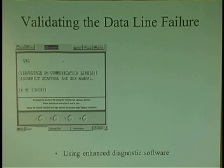Or how about the guy who says the car won't pass inspection because they can't communicate with it. So I go there with my tool. I use OBD II, hook in, and I communicate. Mine works. Well, his doesn't work. So let me just extend this thing out, so we can both tap in real quick instead of going into the dash. As I wiggled it, the lights would come on and off. I'm like, it's got a bad connection here. So I got a good connection, plugged his machine on, and it communicates. Do you realize the pins in that OBD II connector were slightly worn, and his connector just didn't mate properly? Maybe his pins were a little thinner than mine. So it was all about a connection problem he couldn't see. I'm just saying, little things like this help your diagnosis.